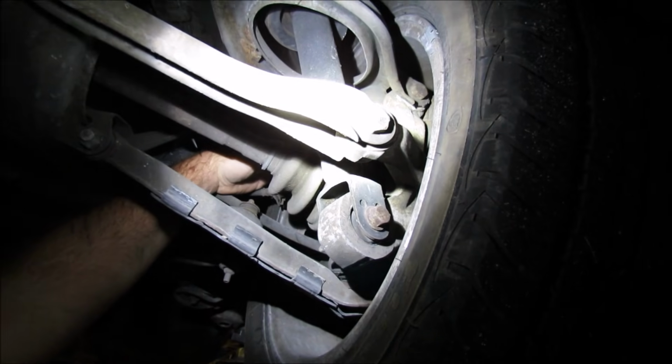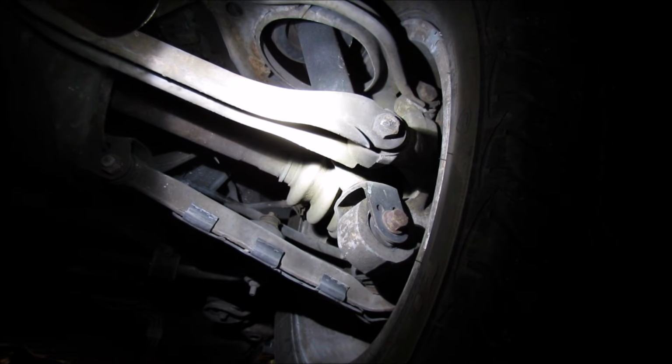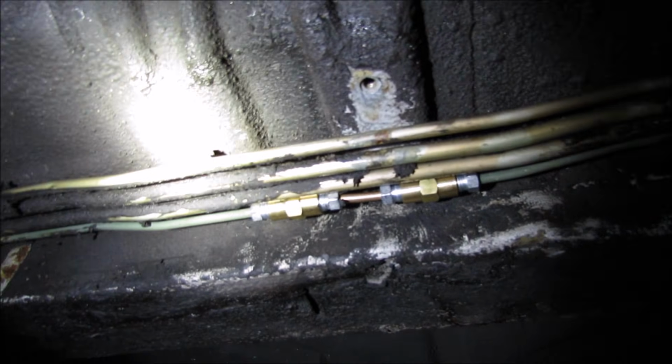So your next step after patching the line is to refill the brake fluid reservoir. Then you got to bleed the brakes. Now with pressure in the lines, we see that we have no leaks, so job well done. Go ahead and do it yourself.